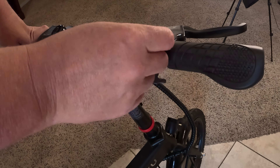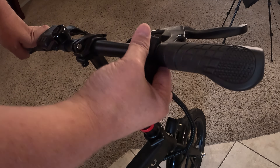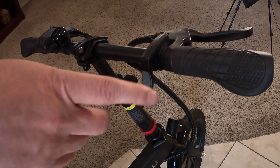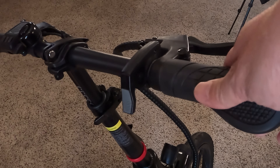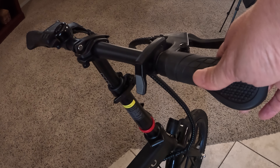If I try to tighten it all the way down, the housing would break — it's made out of plastic. So for this upgrade I'm going to remove this and put on a twist throttle. It's not too hard, not exactly plug and play, but I'll show you what wires you need to swap.